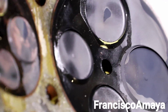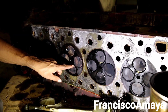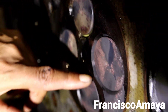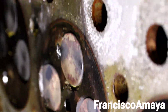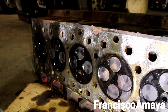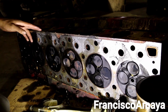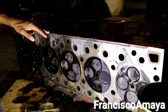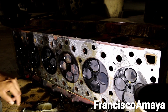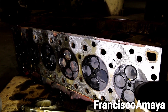That is how it looks when the cylinder head is completely cracked. We have another crack right here, and another one right there — a little hard to see but it's there too. We have similar cracks in the other cylinders as well, which is completely bad. This head cannot be reused. If you take it to a machine shop, they will inspect it, realize it has cracks, and the head cannot be reused.